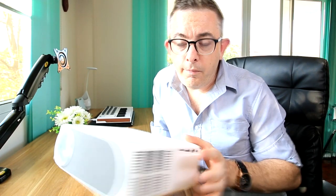As well as all the media players and the online streaming services that you can use, this will also support AirPlay. So you can stream from your iOS device straight to this, which obviously avoids the need of any cables. And the same goes for Miracast as well. So for example, if I wanted to stream from my PC to the projector, I can do that without attaching any wires. I did try that — there is a slight delay, not noticeable for video and sound, but it is noticeable if you're trying to play a game. So I would always recommend the HDMI for super fast connectivity to your computer devices.